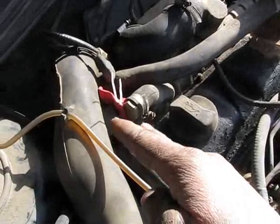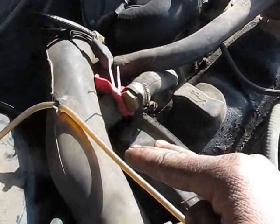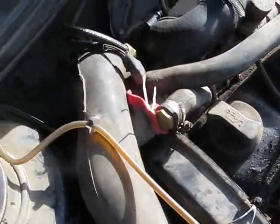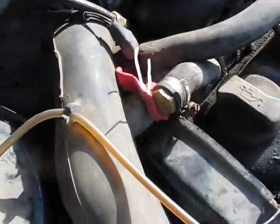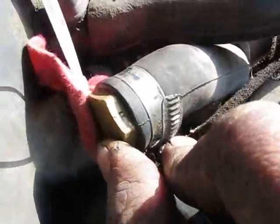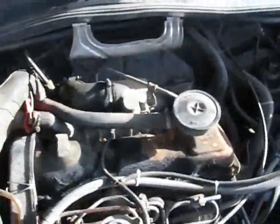It was going 15, 8, 15, 8 and the motor was just surging. I did some reading on the forum and everybody said you've got to block off your blow-off valve. So I just stuck a brass plug in there and zap-strapped it on, and now I can hit 20 pounds - friggin' rights!